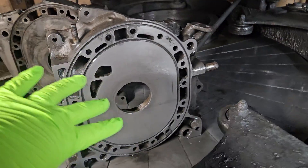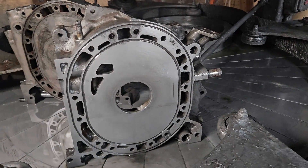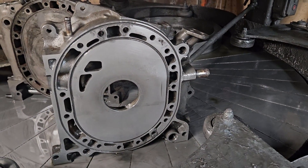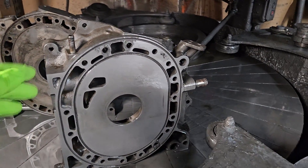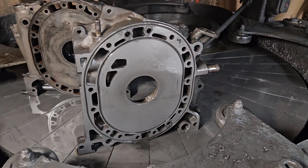I've covered it in the past. Obviously the nitriding is there for reasons. When we lap housings, we're not trying to cut off so much material that we are removing all of that nitriding. So there are specifications that you need to work within when you're resurfacing rotary engines, side housings, or even piston motors for that matter.